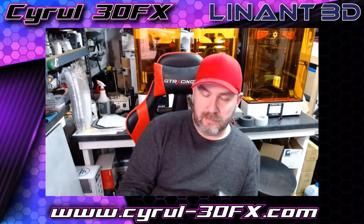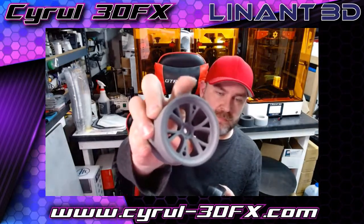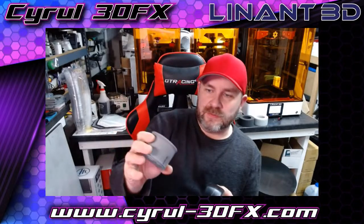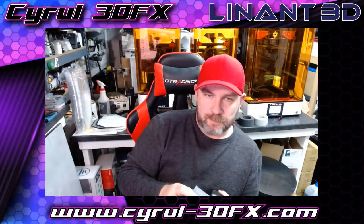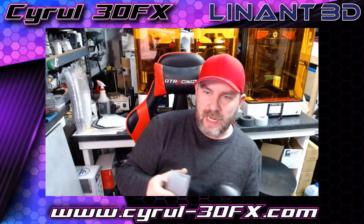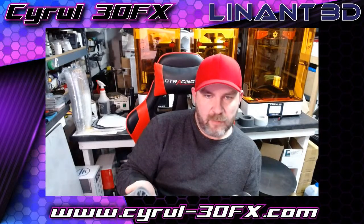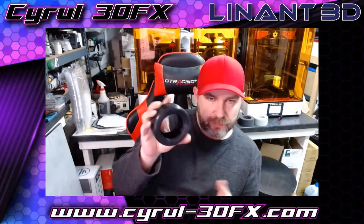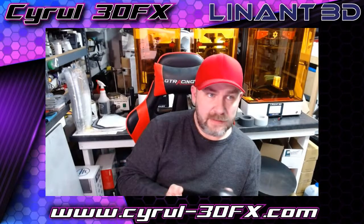The foam inserts are going to be important for our tires. You'll have a baseline, a good side bite and stability, and then if you want to tune further, we have our air ports where you can thread in Schrader valves and tune with pressure as you would with a normal tire. The foam will allow us to have lateral preload and stiffness for a better-performing tire with a softer radial, so you're going to have more traction.